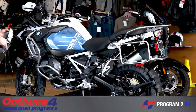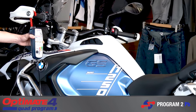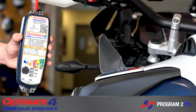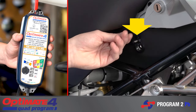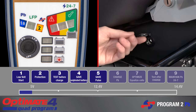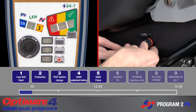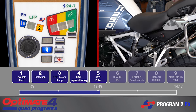Program 2 is for keyless charging and maintenance of a healthy lead-acid battery in a BMW motorcycle with connection via the 12-volt CAN bus controlled socket. Charging automatically starts from 5 volts, the lowest voltage expected to power the CAN bus system in the motorcycle. The CAN bus LED will blink until connection to the battery is established, after which LED 3 or 4 turns on.